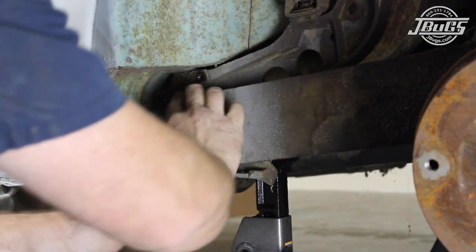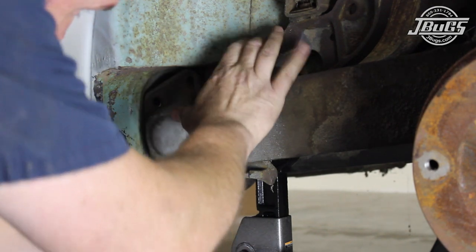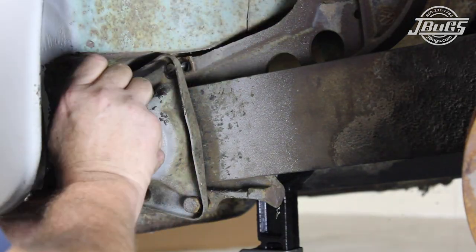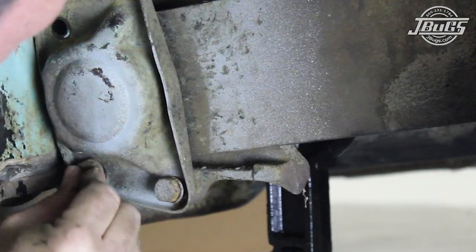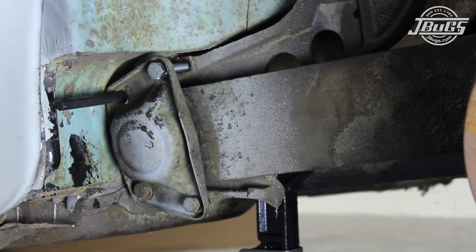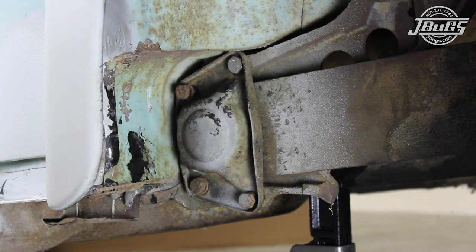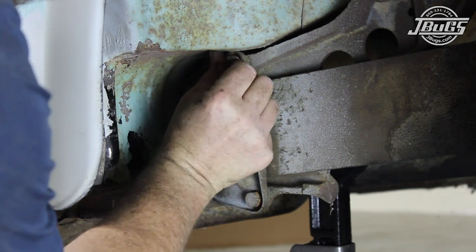Another spring plate bushing is set on the plate, followed by the spring plate cap. Bolting the cap down will be difficult because of the new bushings. Start by threading in the rear lower bolt a few threads. Then a center punch is used to pull the spring plate up at the rear upper bolt hole while threading in the lower front bolt. Then a temporary 40mm long bolt is threaded into the upper rear hole and bolted down. Then the upper front bolt can be installed and all three of the factory bolts can be tightened. Then the temporary bolt is removed and replaced with the factory bolt which is tightened down as well.